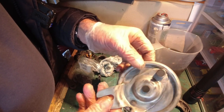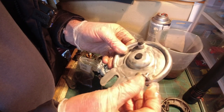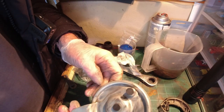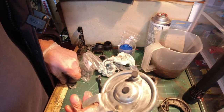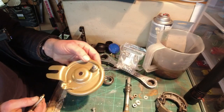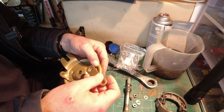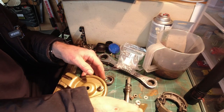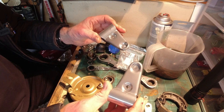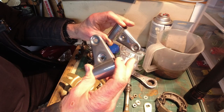So I'm going to get all this cleaned up and prepared so I can powder coat it. I've given it a bit of acetone to make sure it's all clean. There's a temporary bolt in there just to save the thread. I'm going to use this gold again - I haven't got any new gold, so I'll do my best with this lumpy gold. I'll just do those and let that cook for a bit. There we go, that's come out quite nicely. I've also just powder coated the headlight bracket fittings in chrome.